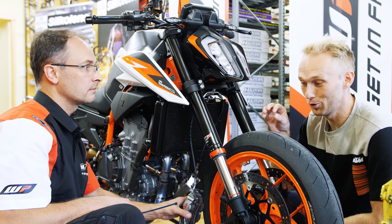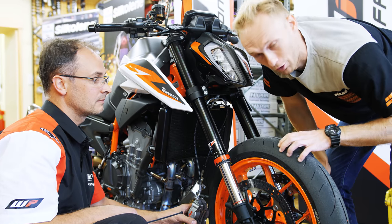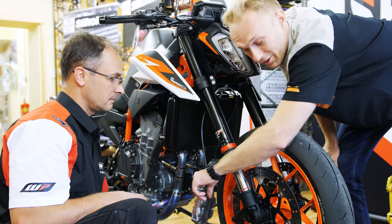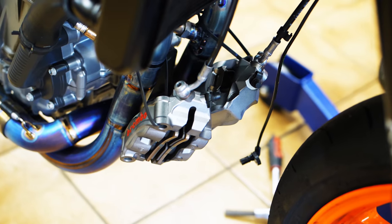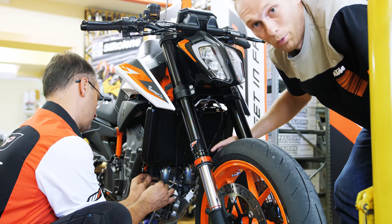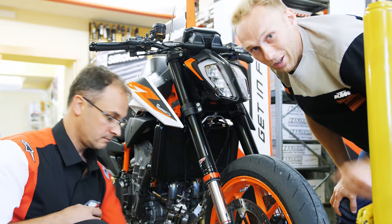I just learned a new tech trick: when you take down your front wheel, the brake calipers are usually dangling around and can hit the rim. A quick trick — just take a zip tie and zip them to the exhaust or crash case or some fixed point, so they're not flying all around. That's cool.